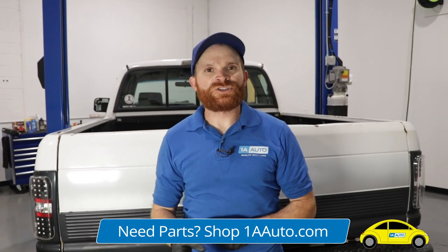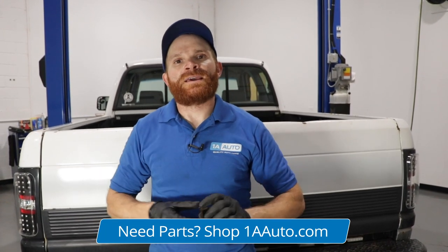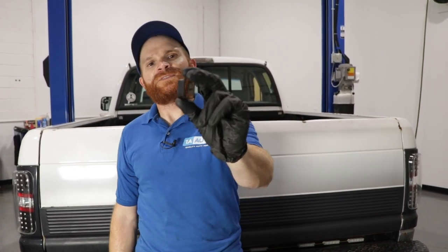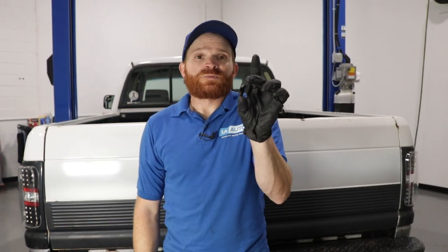So we figured out what's going on with our tailgate. We didn't have very much of an issue with the latches themselves — luckily, if there was, they're really not very hard to replace. For us, it was down at the hinges. The hinges were supposed to have some little bushings like you saw before, and it's a good idea to replace them if they start looking like this. Ours in particular only had one piece — it should have had four pieces. So why is the tailgate rattling? It doesn't have the plastic bushings in between the metal. That's somewhere you have to check, and like I said, you want to check those latches too.